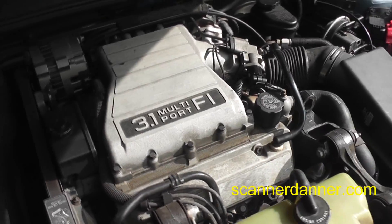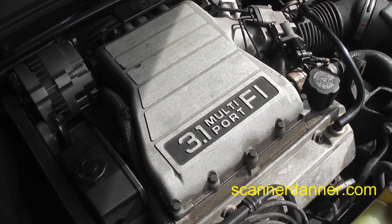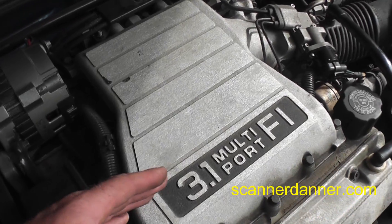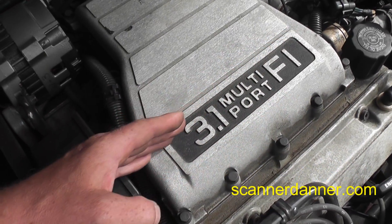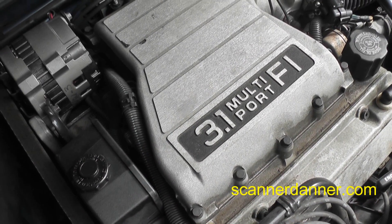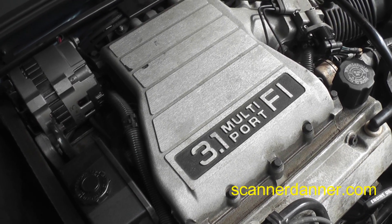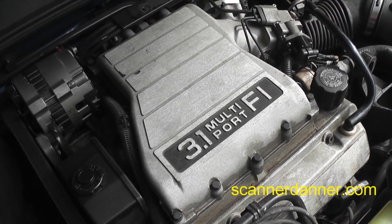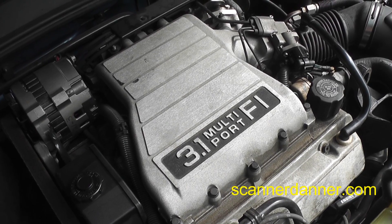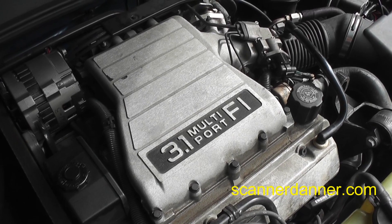Last comment for those who don't have a scope and want to use an ohmmeter to check for shorted injectors: keep in mind that when I first measured the blue trace — these front three — I had a good waveform. After it heated up is when I saw excessive amperage and the straight-up line suggesting shorted injectors. Temperature is everything.